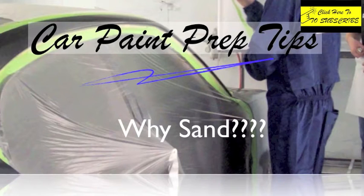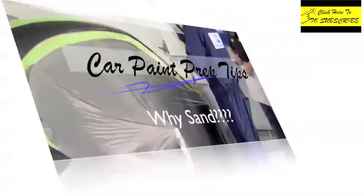Takes less effort. And then if you're clear coating, if you're not putting any paint on and you're just clear coating, if you use 400 grit scratches, you're going to see through that and you're going to see the scratches. So you've got to go with something finer. So anywhere from 800 to 1200, if you sand it with that, you're not going to see the scratches through the clear coat. Now you're going to have to work a little bit harder because it's a finer grit, but it'll all achieve the same thing. So just wanted to touch on that a little bit.